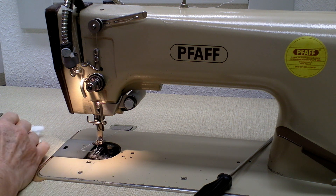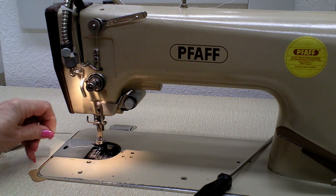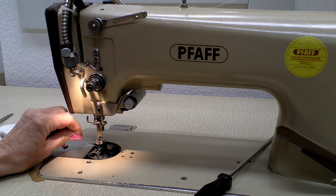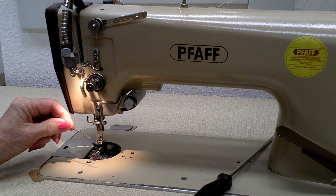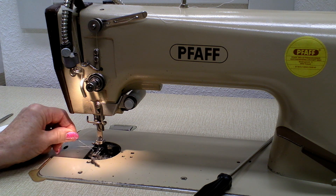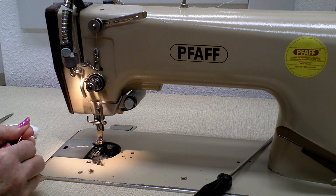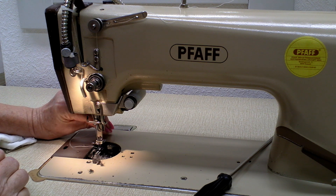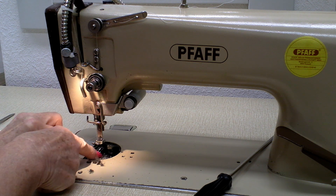Now we have a close look at our transport underneath. And you can see there's so much dirt sitting around. There are many ways and many tools you can use to take this dirt out. I'm using first of all a long pin or needle, mainly to show you how thick the dust is actually sitting in there — how it has gathered up. What's also very good to use are tweezers, a brush, and a blower. I use all those things at different times, depending on how thick the dirt is sitting in there.